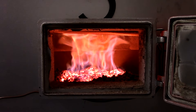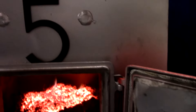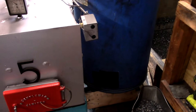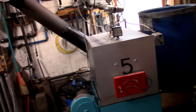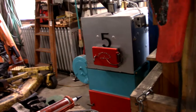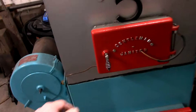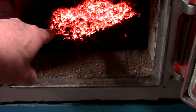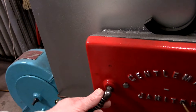It really turns out it's more the chimney than anything else. We just finished a heat call, so currently we're feeding out of a barrel right on the end of the pot auger — no bin auger involved. What we thought the problem was: we were getting a whole bunch of crunching coal noises, and it was actually making the fire dead on basically the left side front here. That's from fines getting pushed up into the pot.